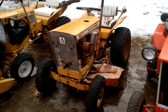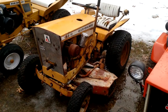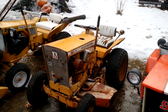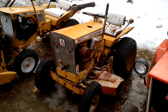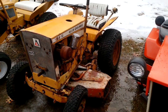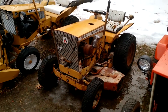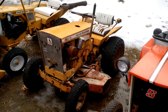It does have some patching on it but it looks good. This one doesn't run yet — I'm getting a very, very dim spark on it. I think I need to clean the armature and the flywheel. This one has the coil where you have to adjust it, and I'm trying to remember if this has the magnetic coil under the flywheel or not. I need to put some air in the tires — they're not leaking, I don't even think.